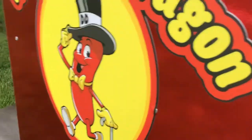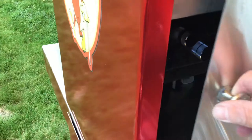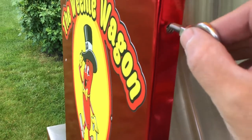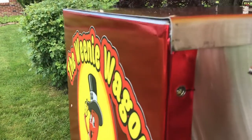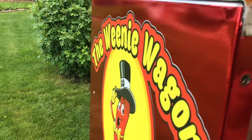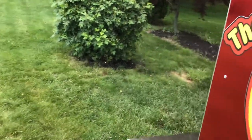Another thing I don't like is there's no way to keep the bread box doors shut when towing - they open up and rattle. Most people use bungee cords but that'll scratch your stainless. What I did was drill out the panel, install a nut-sert with a special tool, then before towing I just put a bolt in there and snug it down - keeps both doors nice and tight and locked. I wish they would include these from the factory.